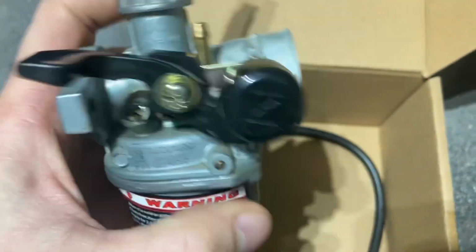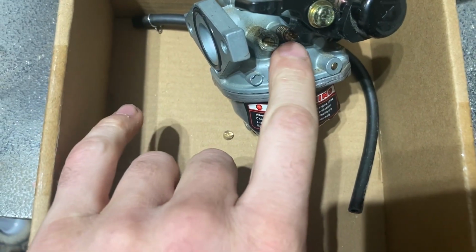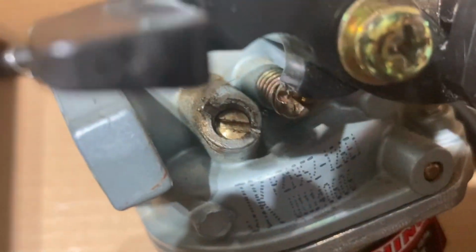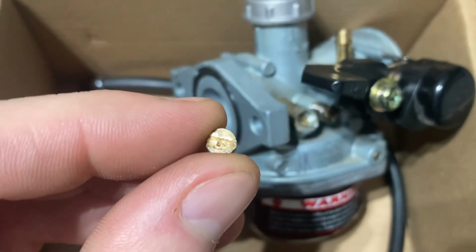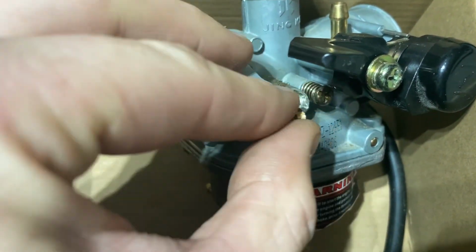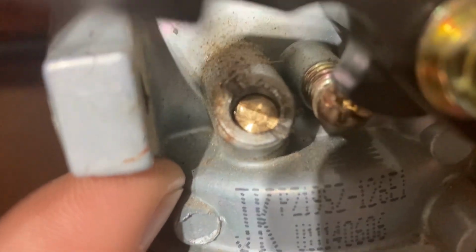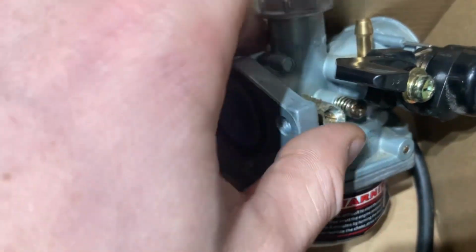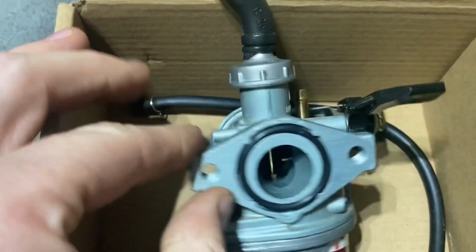So right here, and I don't know a whole lot about carburetors, I'm still learning, but there's an adjustment screw right here, which didn't seem to do a lot, honestly. And then right here, well, first, there was this little brass plate in there, and I Dremeled it out to make it so I could get a flathead screwdriver on it, but that was covering it up. So they did not want you messing with it. But then I Dremeled it out, and that's an adjustment screw as well. But I tried both of those. It still didn't work. It kept stalling out. So I just bought a new one off Amazon, replaced it, messed with the tuning just a little bit.